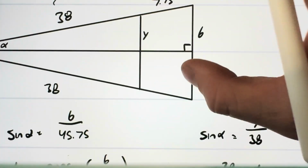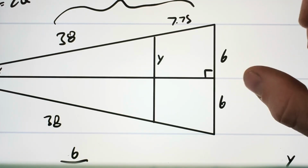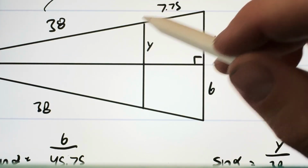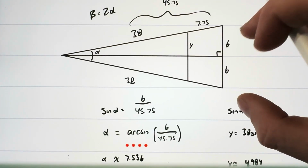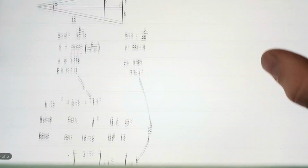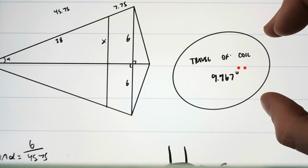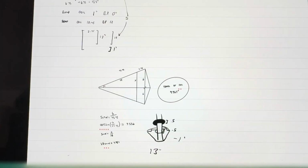this coilover is not going to travel the same distance as the shock. So the fact that you lose an inch doesn't really matter as long as you are within that 1 more inch that you have. So the important thing to know is don't let the coilover limit the travel of the beam. It has to be the front shock because that's the one that's traveling the most distance. So we'll go back out to the Bronco and start getting the location set for the coilover and the shock.